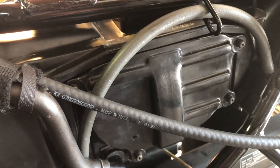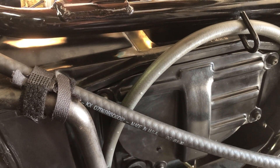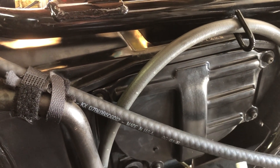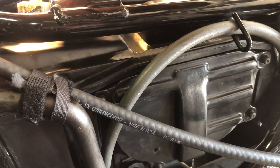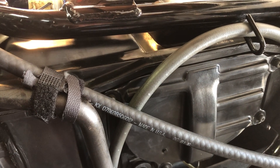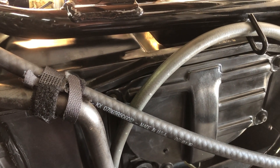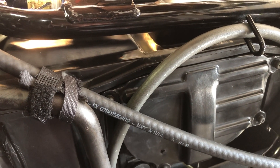Also for the test, you should remove the air cleaner, which is hiding behind this cover. There are only four screws and then a little tab at the bottom of the air box which can be pulled out, and then the air cleaner can be removed from the air box — this is going to allow your engine to breathe easier during the test.